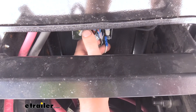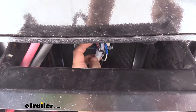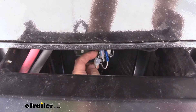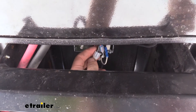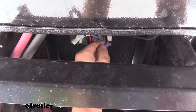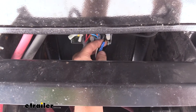Your breakaway switch is easy to install — there are only two wires that hook it up. One hooks to a constant power. We've got ours hooked to the seven-way charge wire coming into our trailer. We did this because it's also wired to the batteries inside our trailer, so in the event of a disconnect, we still have power coming from those batteries. So we have power all the time on one wire, and the other wire goes to the signal wire on your braking system.